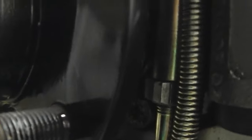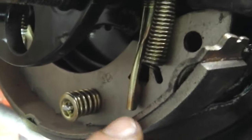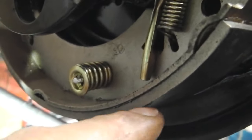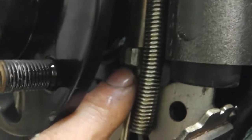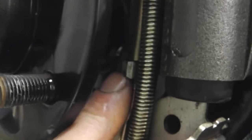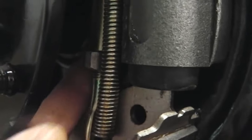That wheel should turn. There it is, can you see that? There it goes on the upward click. So it's now pushed the forks out a little bit because it's finding that there's a gap here between the drum because they've worn down. What would happen if there was no gap is the ratchet would just slip on there because it wouldn't be able to force the fork out anymore, and then there would be no turn, so that would just click on it.